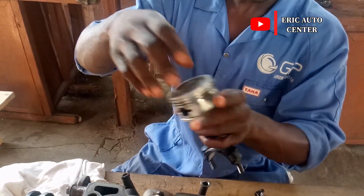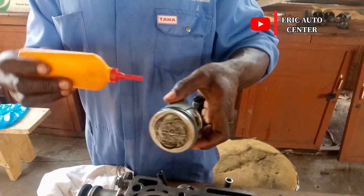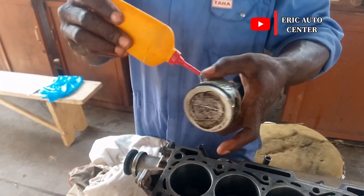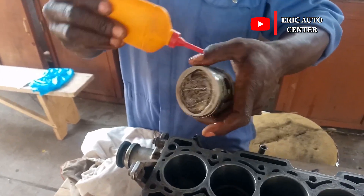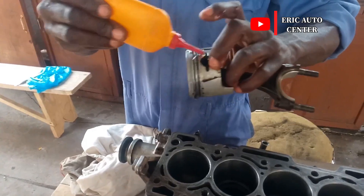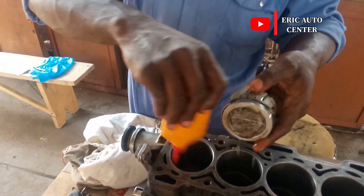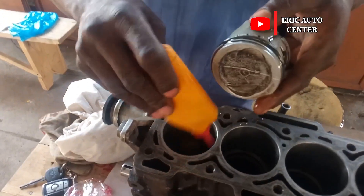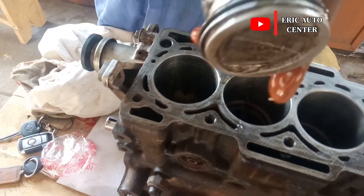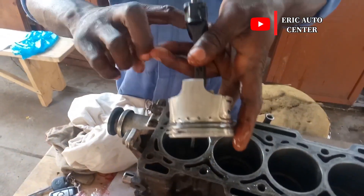It's pressing the other side of the piston, and it's about to clamp — but don't forget to oil it, because oil is very important for the rings. If you don't, you'll do a wrong job and the piston will be sticking when you start the engine. So I have to oil the whole piston and the rings, then oil the internal chamber — which we normally call the lining. Also don't forget to oil the connecting bearing.